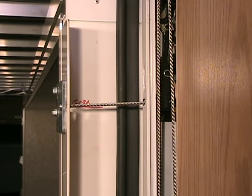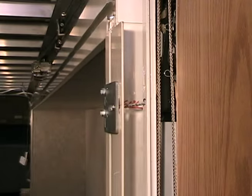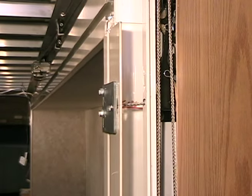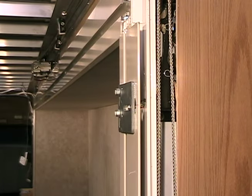Ninety-nine percent of all cable failures are caused by improperly placed standoff brackets by the installers. This causes a situation where the cable gets into a bind and the room may not close fully. Notice how the cable is not going through the hole in the jam anymore — it's being forced down through it. If this were a room running in on an outside cable, the cable would be in tension while the coach was going down the road causing vibration, creating cable failure by fraying the cable one strand at a time.